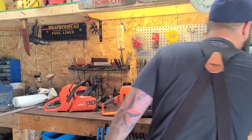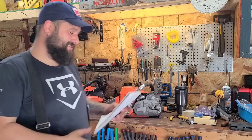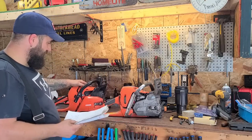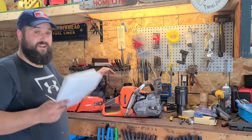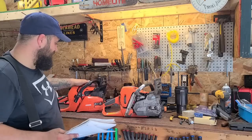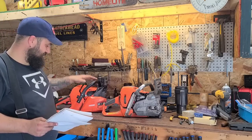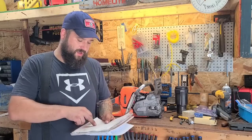I timed everything — sat down in the chair and had a coffee and timed everything. Do times matter? Not really; I usually don't time cuts unless I'm trying to prove out a theory. We're going to be porting some saws in the near future and I want to prove out a theory, so I'll be timing cuts for that. Okay, let's start with the 590. Today, 12,500 RPM is the highest free-rev speed I could attain with this saw. It will often hit 12,300 and then hit a wall — semi-fixed high jet for sure; it starts dumping fuel in as it gets lean. So if you're tacking your saw and that's all you're getting, well, that's what I'm getting too. 12,500 RPM.